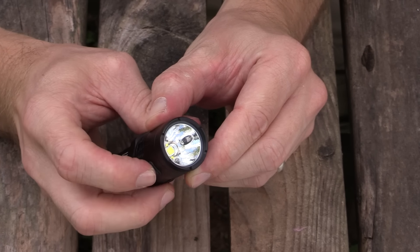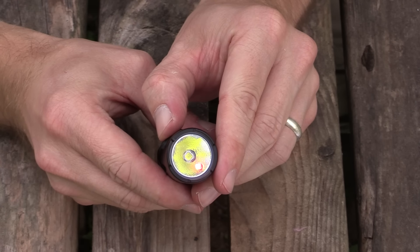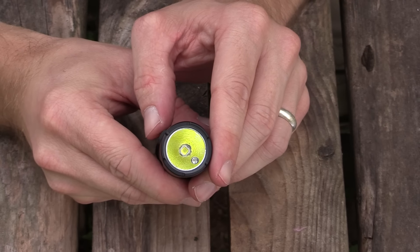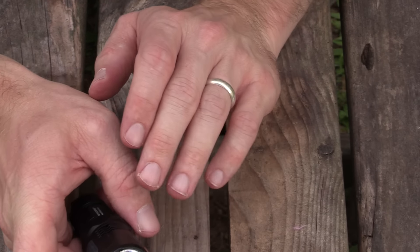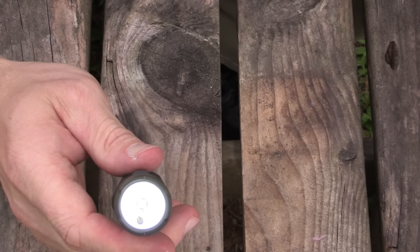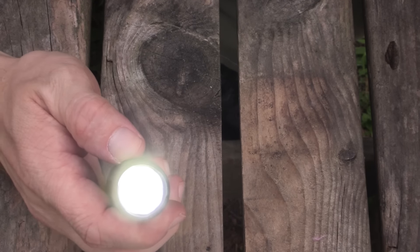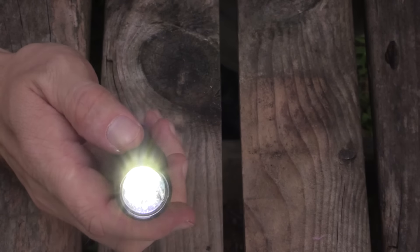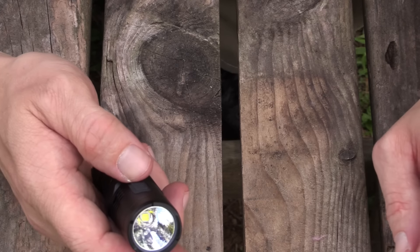When the flashlight is off, you can hit the mode switch which turns on the red LED. You can then hold down the mode switch to activate the signaling red LED — it's very cool. With this flashlight you have all the typical settings you'd expect: the lowest setting is 1 lumen, next up is 70 lumens for low, 160 for medium, 300 for high, and 900 for turbo. You also have strobe, SOS, and a locator mode.